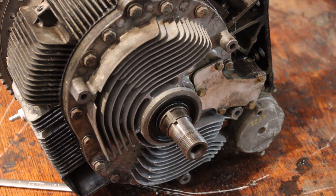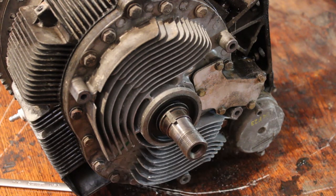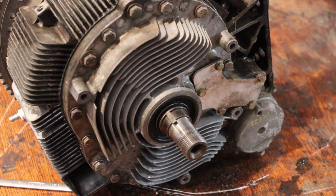We got everything off that we needed to get to that cover — that was actually a lot easier than I expected. The counterweight and fan came off super easy, just shot it with the impact wrench a couple times and it popped right off. Hell of a lot easier than some of the other stuff, like getting the belt off of this thing, which absolutely sucks. The secondary clutch halves were kind of stuck together from sitting so long, so I really had to keep working at it. Not like newer sleds where you thread in a tool and pop the belt right off.